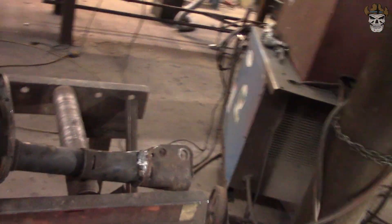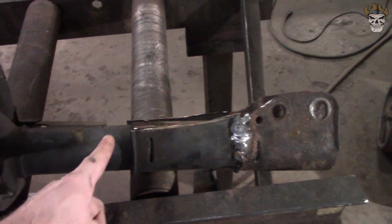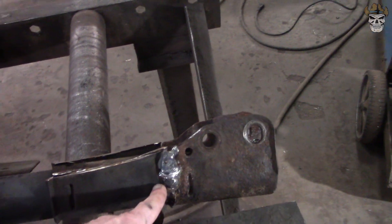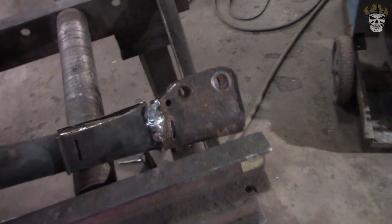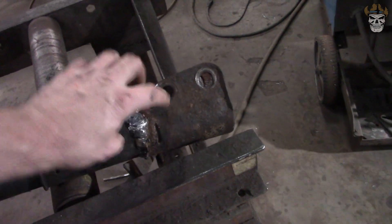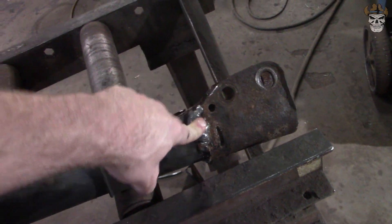With the strut off, I want to show you what we did for our lift. What we ended up doing is I had another pair of struts from the blue Oldsmobile, and we ended up cutting them right here and then welded that on the end. What that did is move this eyelet from here to here, which gave us five inches of lift — five inches from eyelet to eyelet. Then on our subframe drop here we moved it four inches, so technically we have five inches of lift with just this. I'm not done with this — I still want to take a piece of steel and connect these two all the way around so it's not just this joint supporting all the weight.